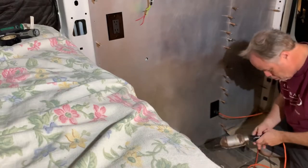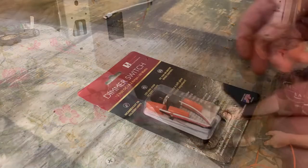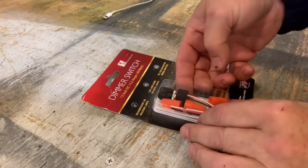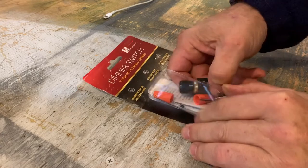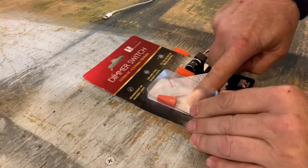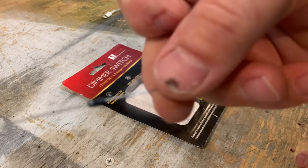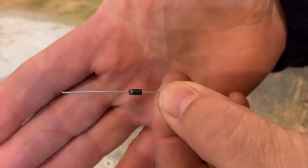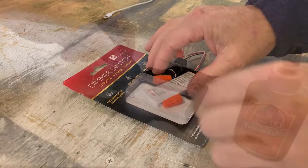With both 110 plugs wired, I quickly tested the wiring by plugging in a trouble light. Being fully transparent, this is the second dimmer switch I purchased — twice the price of the first one, but this one works. I'll provide a link in the description. You definitely get what you pay for. Just as an FYI, it also comes with a diode, so if you're planning on making a fan or other electric motor variable speed, you could use this dimmer switch to do it. You don't need the diode for dimming LED lights, but it's good to know for future projects.